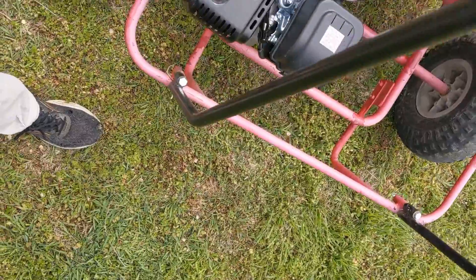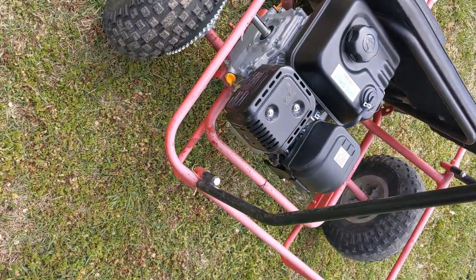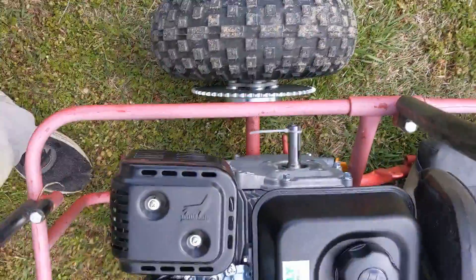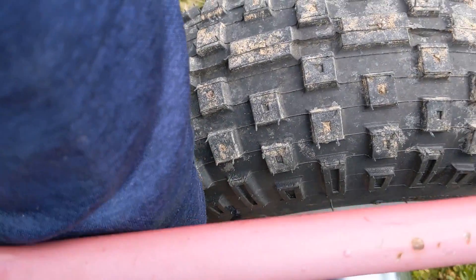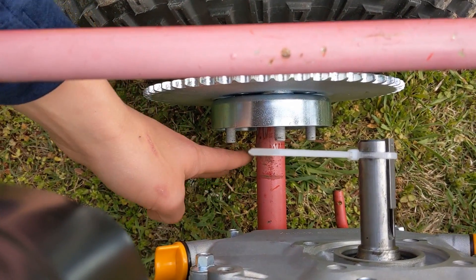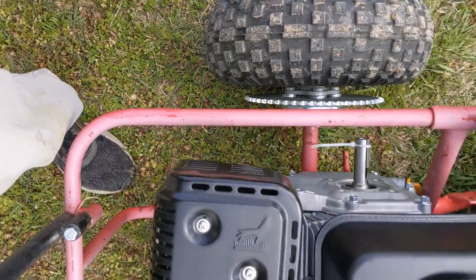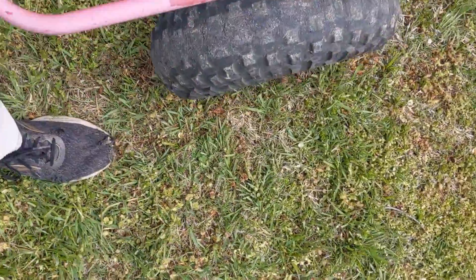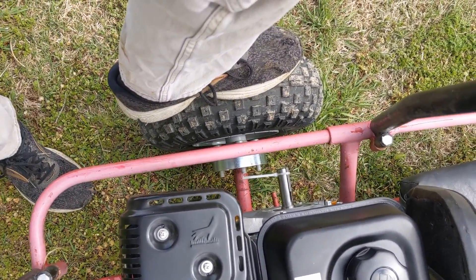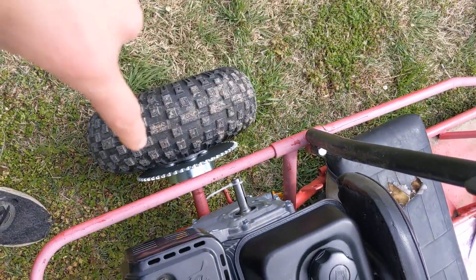So the issue I was having is that I didn't get enough oil into it because the oil sensor was tripping. Even though it was dripping out of the spout on flat ground, I jacked up the back end so it sloped, got more oil into it, and then it worked fine. We've got a bit of an issue — the end of the bolts means that even if I space out the sprocket all the way, it's still not going to reach the clutch. So I'll probably have to cut the pipe back three inches and re-weld it to make the pipe shorter. Also, there's a gap here, and the wheel is under the bar by about an inch, so we think cutting it will also make it look more symmetrical. Next video will most likely be hooking up the throttle cable, and after that we'll probably be welding this.